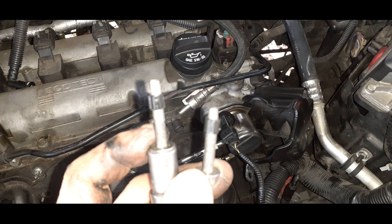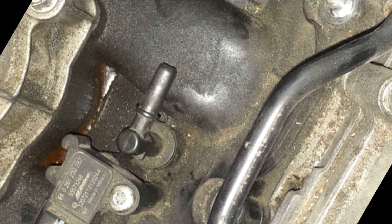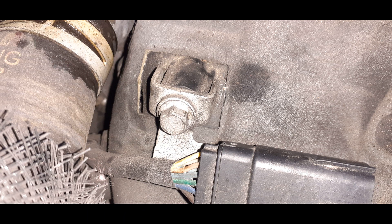I noticed these little sleeves — this would be holding down the throttle body and there's a secondary fuel pump with these little sleeves. Then a slide-back lock on these connections. Remove this with the 10mm and it'll let this fastener go free off the intake.